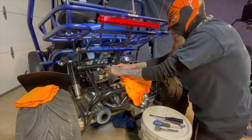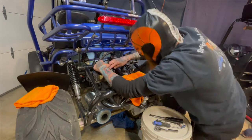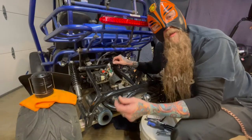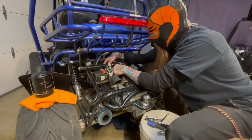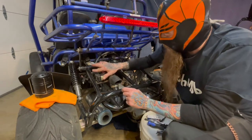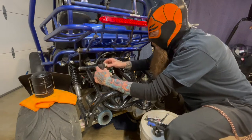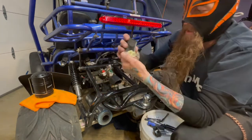Here's our ignition — this right here is our coil and ignition. Through the magic of video we got that stubborn bolt out. The bolt held our ignition coil in, and once you get it out you can just weasel it on through. Put it to the side for now. Right here is your CDI — it's held on by a little strap. Take the strap off, that gets your CDI right there, and then you just unplug it. That's your old one — see, no adjustment.